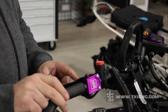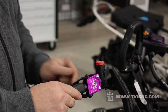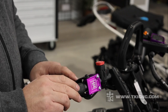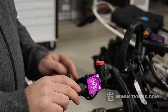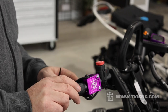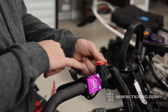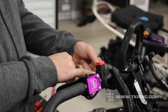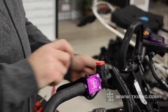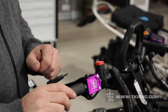The other thing you want to check is when you go wide open with your throttle, reach in and grab the cable to make sure there's no more movement. You do want a little bit of gap between the throttle flipper and the face of the throttle block to make sure that the butterflies in the throttle bodies are completely closing. I have about the thickness of two credit cards in here, so that'll be just fine. If you want to adjust it, there is a shiny black sleeve on the inside of the handlebars — if you cut the zip tie, slide the sleeve off, then you can adjust that cable. In this instance, we don't need to adjust it, so we're going to leave it exactly where it sits.